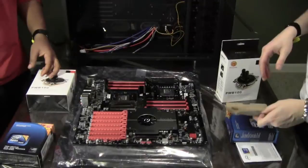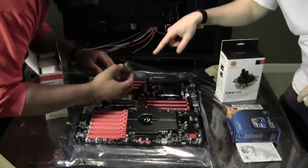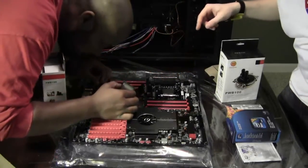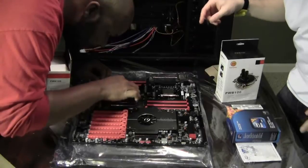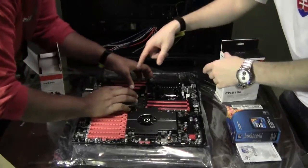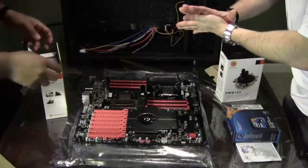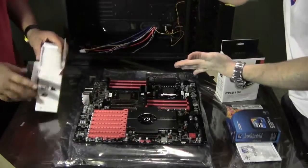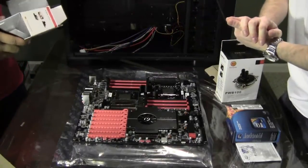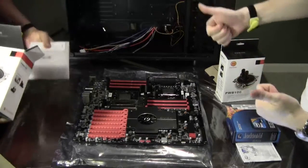Let's go ahead and install it. We're putting the chips in — we've already got one in there and we're putting the second one in. If you're using this exact same configuration or something similar, when you clamp the chip down it makes a little noise like it's pressing down. Don't freak out — it's supposed to push in to make sure all the contacts are connecting and you're getting all the processing power out of it. They're both in, we're good to go.